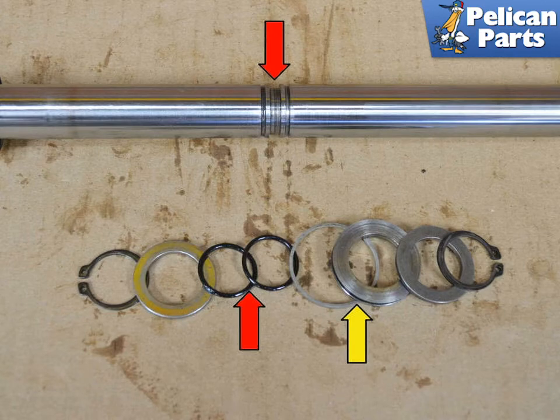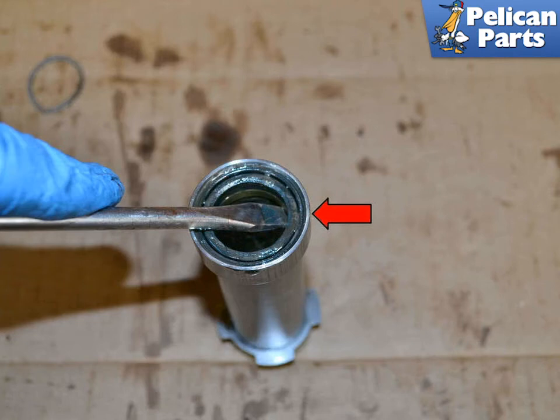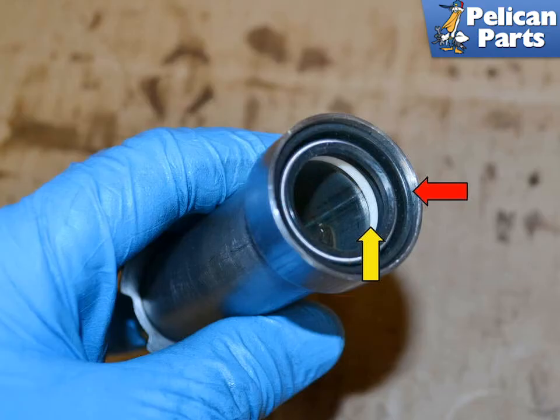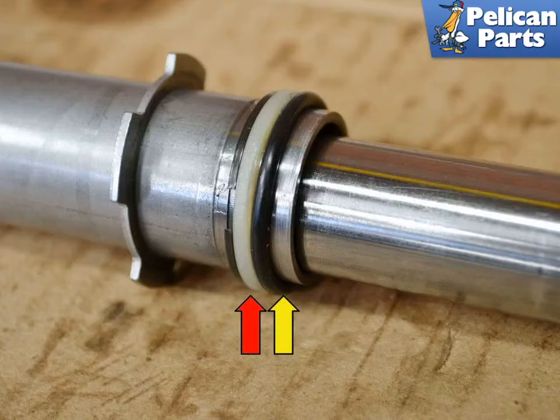Remove the sleeve from the rack. Remove the seal on the sleeve along with the bushing inside. The bushing has a beveled edge — when inserting it into the sleeve, make sure the beveled edge is pointing down into the tube. Insert the beveled edge facing down into the sleeve, then insert the new sleeve seal with the lip facing up. If you insert this lip side down, the rack will leak. Use a socket with the diameter of the seal and press it into the sleeve until it sits below the edge of the sleeve. Reach in and try to move the teflon bushing — if you can move the bushing, the seal is not seated enough. Make sure to install the teflon bushing on the other end of the sleeve and replace the rubber o-ring.